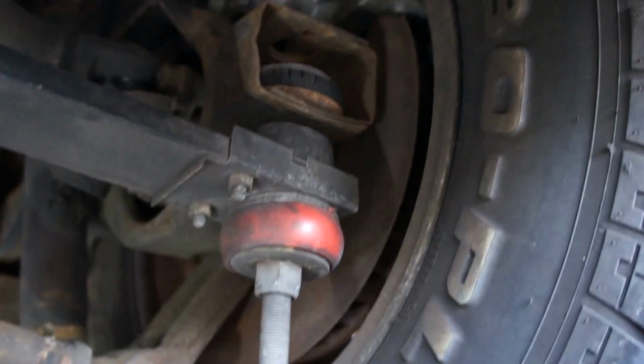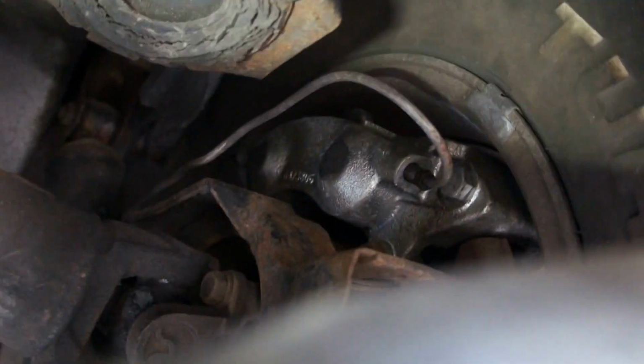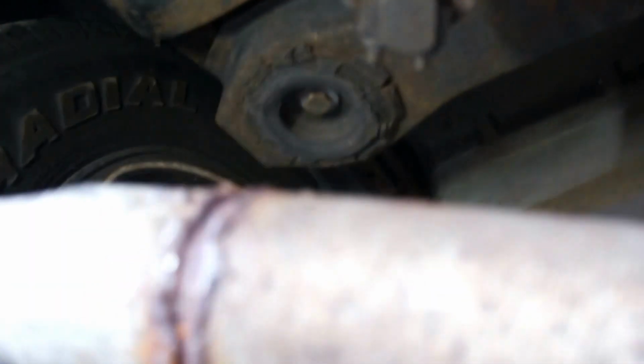And you can see the rear spring has really been crammed up to try and get some ride height on the car. Rear caliper lines are very Mickey Mouse. You see the rear spring bolts are loose. Same on this side. It's actually had a replacement trailing arm on this side, but you can see again we've got the chassis. This section in here is just starting to spread apart, and that would be a relatively easy fix now. So certainly a good candidate for the kind of work we're talking about.